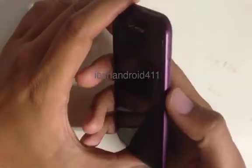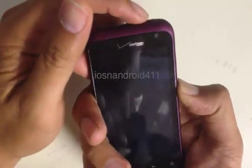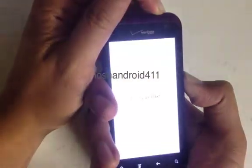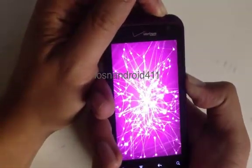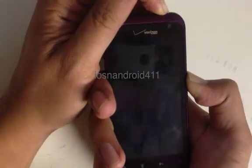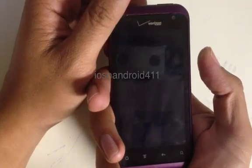The next thing you want to do is press and hold the volume down key, then press and hold the power button at the same time. You are going to be presented with some screens — that is fine, don't let go of your fingers. Then it is going to black out, so once it blacks out, go ahead and let it go. The phone is off.